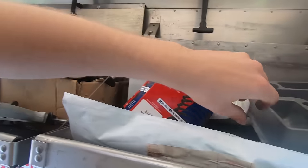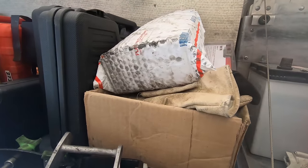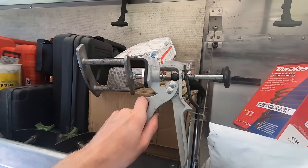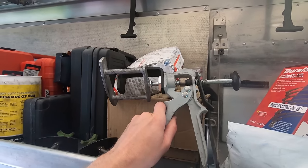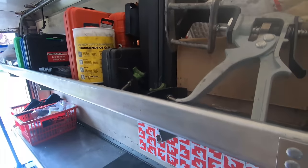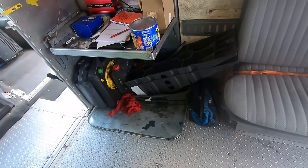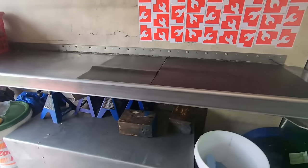Here's the case for the vacuum pump, my inspection camera, and my timing light with a couple of reusable winter gloves. This is one of my favorite tools — a caliper compressor for piston-style calipers. It's worth spending $50 on this if you're going to do multiple brake jobs; it saves a good bit of time and work pressing those calipers back in. Otherwise you use the cheap kind from AutoZone, O'Reilly's, or wherever, but this one works way faster with a lot less work.